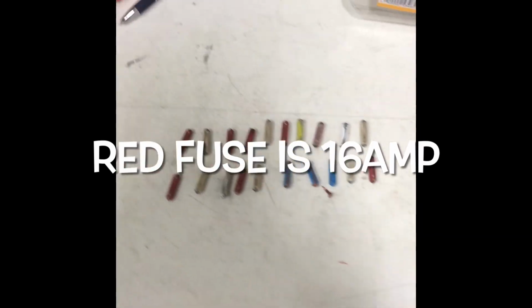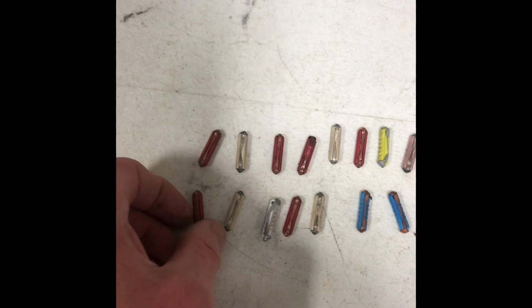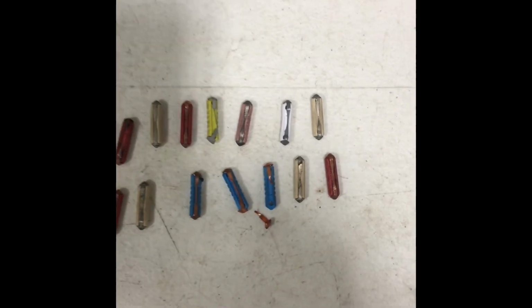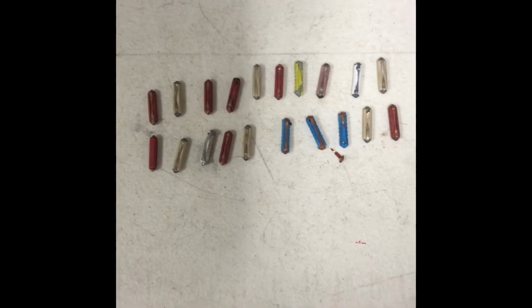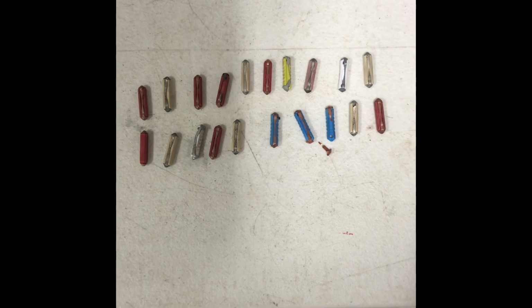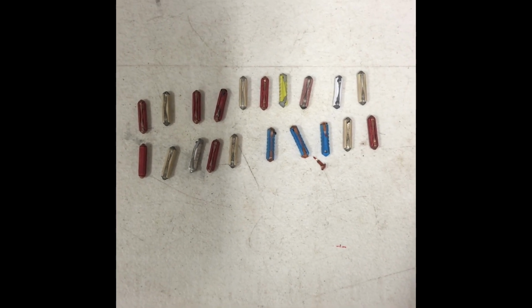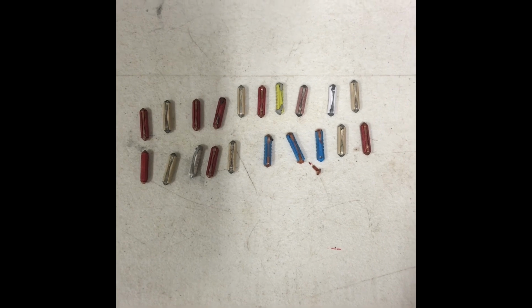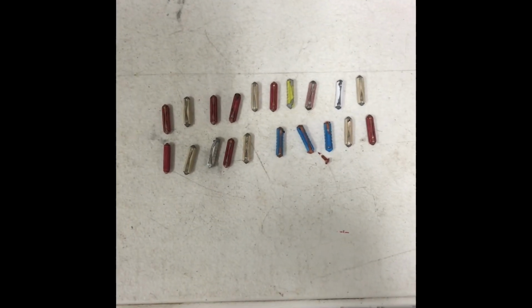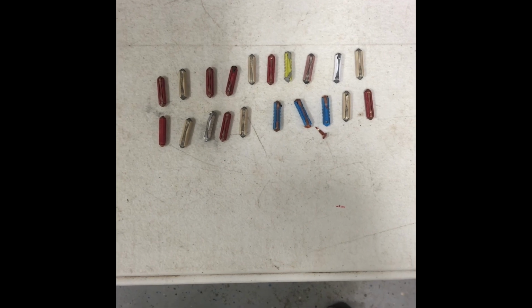Okay, handy tip. You're buying an old BMW, an old Volkswagen, an old Mercedes that uses these old type fuses. Things aren't working. It's not running. Lights aren't working. First thing, look at the fuse box. Get yourself the actual fuse box wiring diagram, okay? Find out what fuse is supposed to be in what hole, okay? Luckily, on a Mercedes, it is posted on the back of the fuse box cover. Not every slot should have a fuse in it, depending upon your model year.